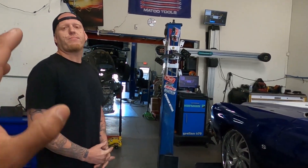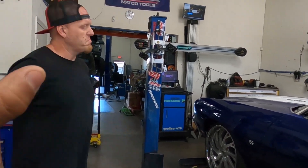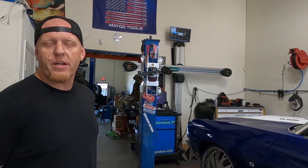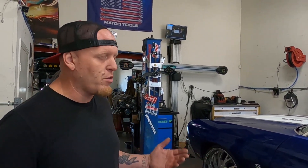As long as you know how to get the car to drive straight and put the numbers in specs, it doesn't matter where your numbers are per se. Other shops say they can only align the car to factory 70 specs, but Mike says he'd align this car to Honda Civic specs if needed — as long as you know how to get a car to drive dead straight and how much caster to put in for the crown of the road, you can align any vehicle dead straight.